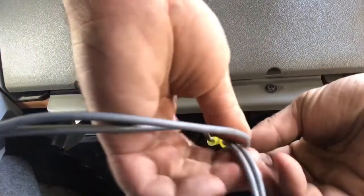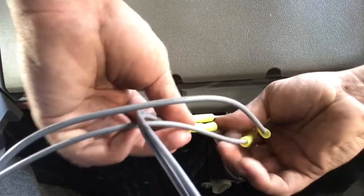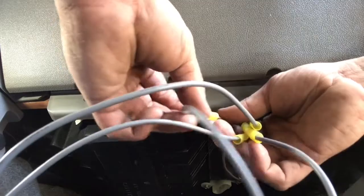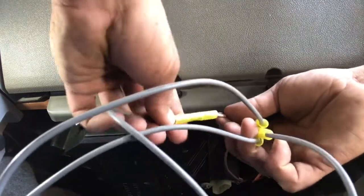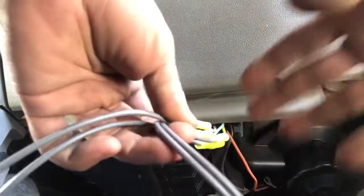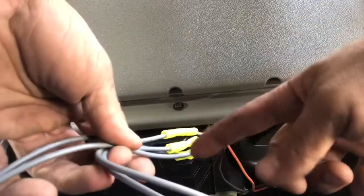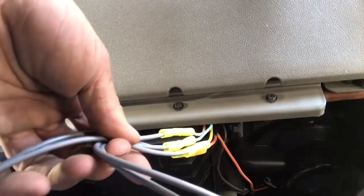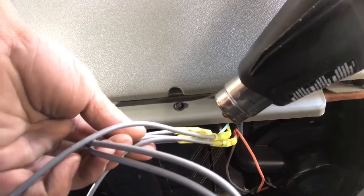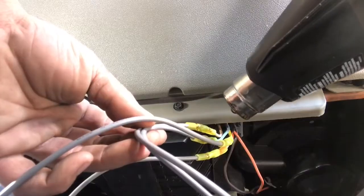Now that I've gotten all the connectors on and they seem to be pretty tight, before I melt these connections, go ahead and give every connector just a little tug to see that your crimp is good and there's no looseness. You definitely don't want these coming apart — if they do start to come apart later down the road, it's going to get really hot in here, just like our connector was. These appear to be pretty good, so I'm going to go ahead and melt these connections down. I really would stress that using a proper heat gun is the best way to go, though a torch or even a lighter works — just be careful not to burn the surrounding insulation on the wires. As it melts, you'll actually see the connector itself become a little more translucent and really snug around the wire, creating a good, tight seal.